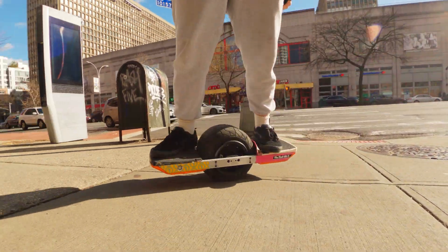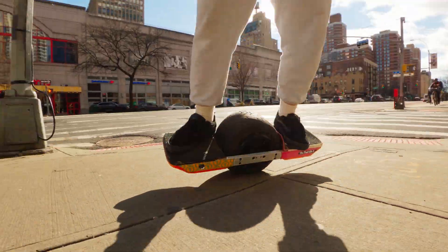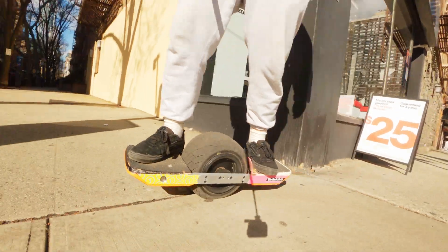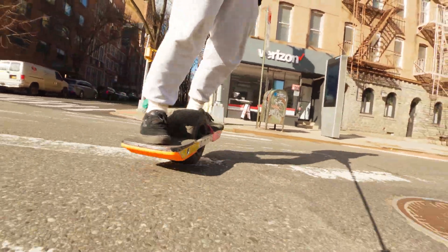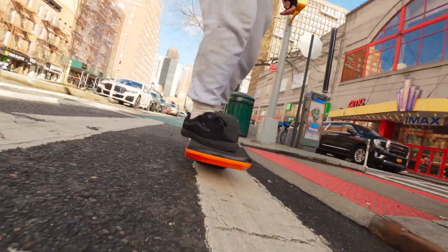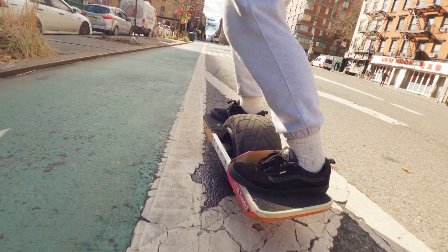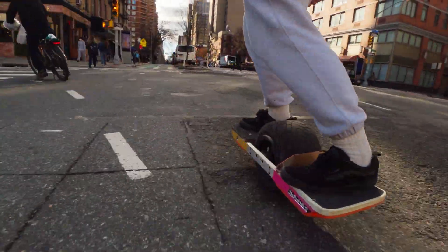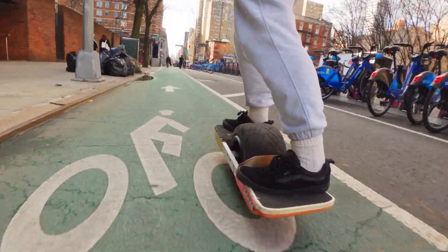Right here I'm doing a spin and you can see just how tight the VESC can turn. I've given my board to one of my friends who rides a GT and even though I already have the settings for turning dialed way down, it still feels super responsive and initially kind of weird actually. It actually feels really weird to step on a VESC and turn for the first time — it'll feel like the board is balancing on the edges. I feel like the VESC is the only way to fully take advantage of the insane shoulder of the enduro tire. The enduro just edge holds so well and the VESC really unlocks that part of the tire. You can actually ride on the edge, which is great for enduro. VESC just unlocks the full potential of it.